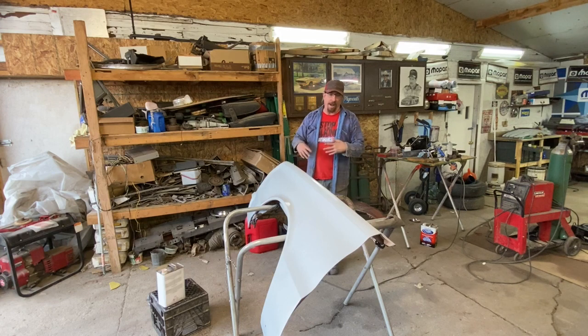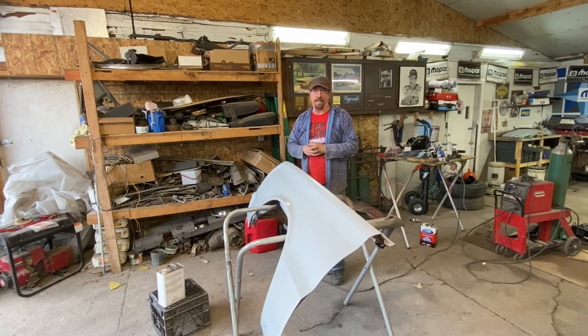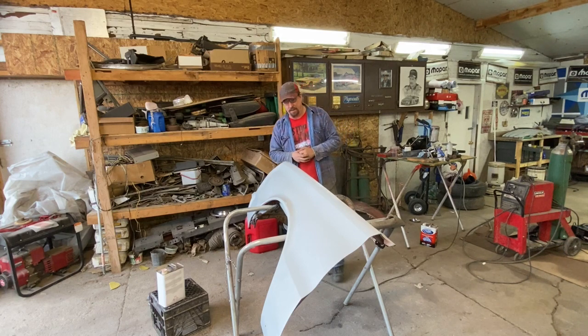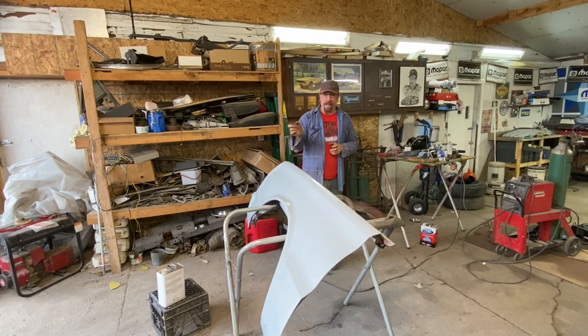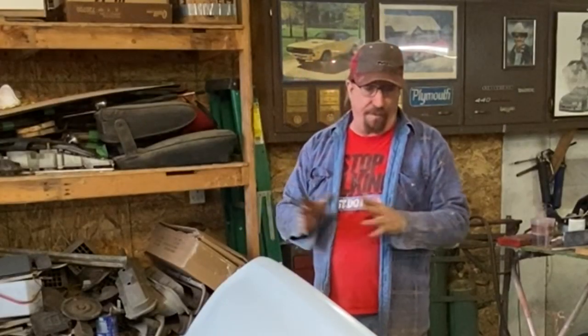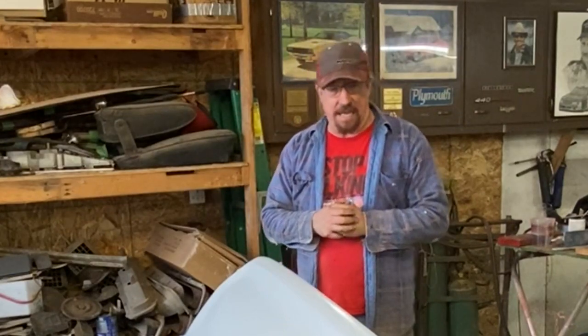If it's over another product, more like paint or something like that, I probably wouldn't put it on that heavy because I don't want it to cause something to lift. But there's nothing to lift under here except some tiger hair and a little bit of that light dusting of etching primer. So it's all good. It looks great. Obviously, it's rough. It's got to be blocked out about 6 billion times.